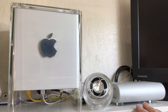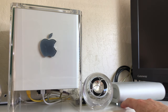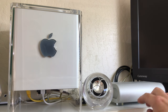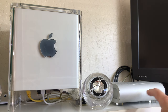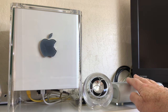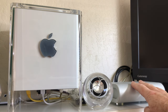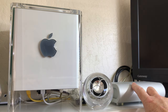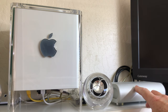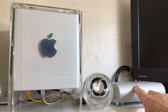And of course, our next upgrade was to the power supply itself, which was very simple, by just putting these tiny little rubber feet on the bottom of it to elevate it off. That allows it to get a lot better airflow, and it definitely helps keep this power supply a lot cooler. That's a nice, simple, inexpensive upgrade to do on the power supplies on these particular machines, because these things get very, very hot. But when you elevate it off the ground like that, about 3/8 of an inch, it keeps it nice and cool.